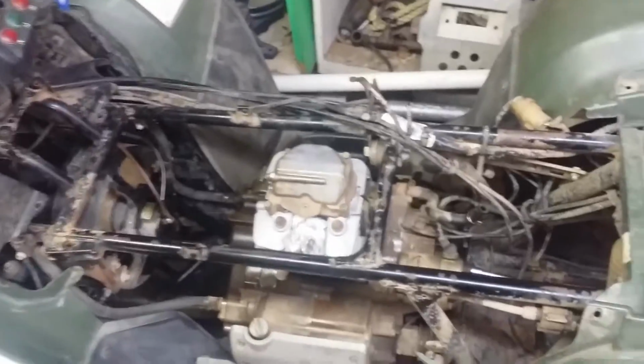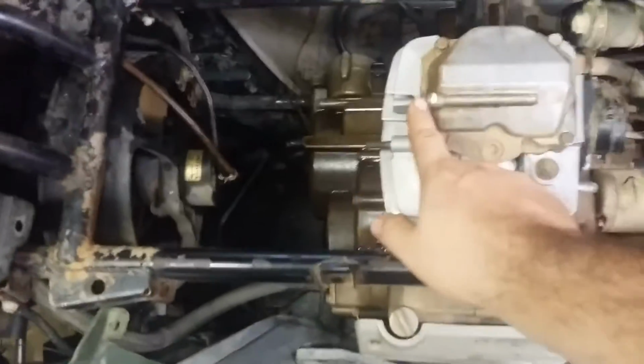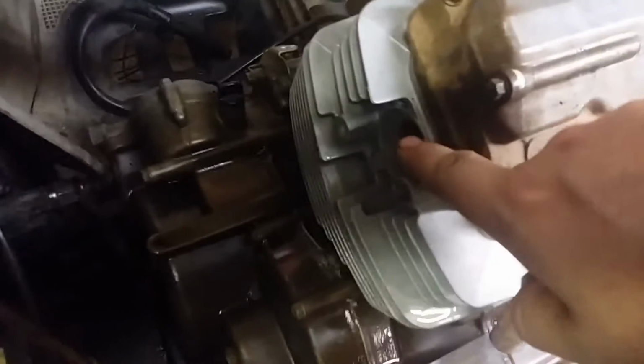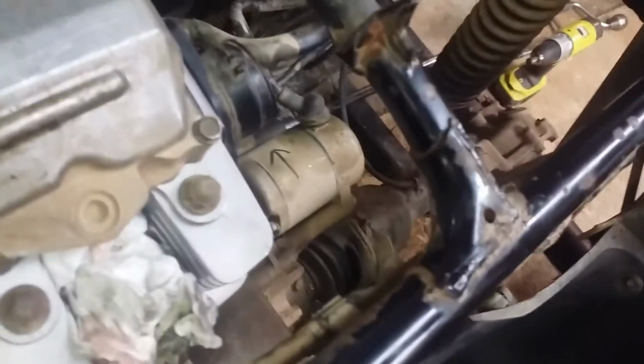Alrighty, this is another part of part 4 for the $40 four-wheeler. Ran out of film space on the camera, so having to film a second part. So far we got everything torqued and assembled on the top end. Got the valve cover, we bled through the oil port. Now the objectives are to install the copper gasket in the side of the head here, install the exhaust out through the back. We're going to spray a little bit of Juju in this intake boot, install a spark plug, and find out if it pops over. Throw a little power at it if it wants to start.